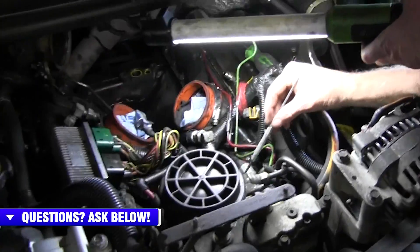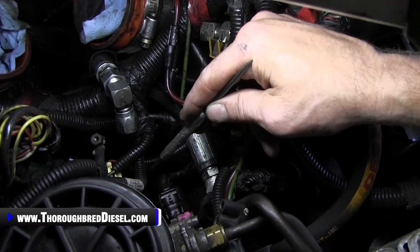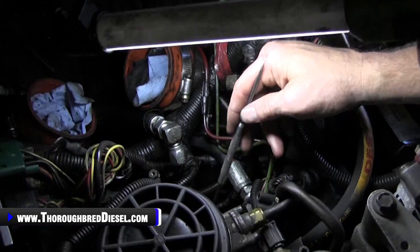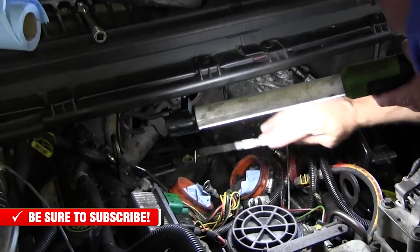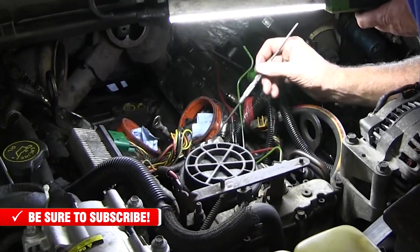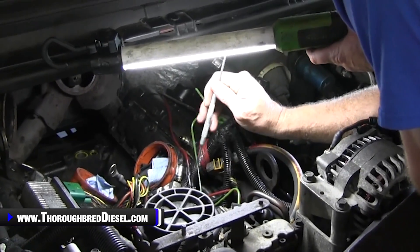Another place — around the IPR valve, we can get a little bit of leakage. And then the back of the high pressure oil pump itself, the big plate can leak. If you've got your oil leakage at the back and there's nothing towards the front, then you don't have to worry about this. If you've got moisture at the front of the motor all the way back, then be suspect of the lines where they join the head — around the high pressure oil pump is another good reason to look there.